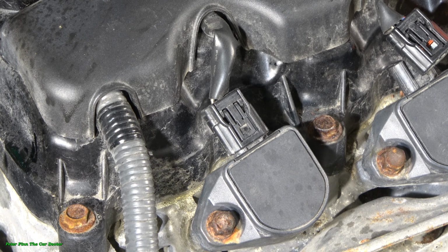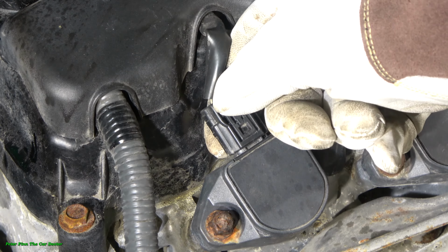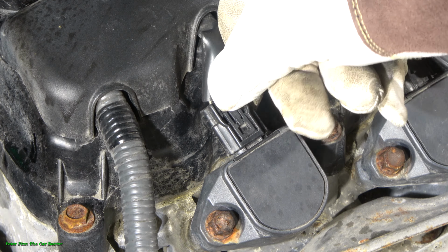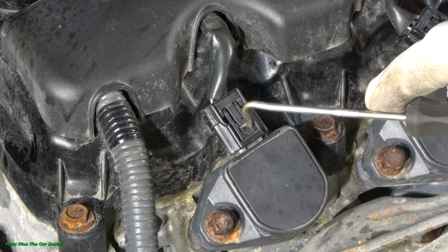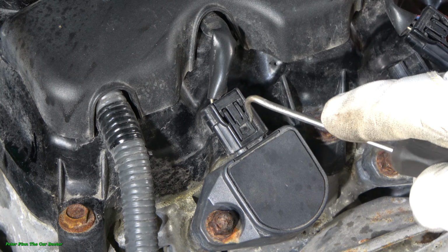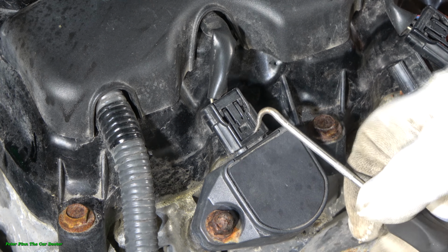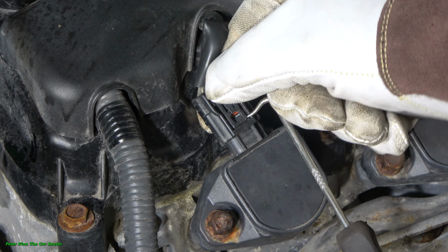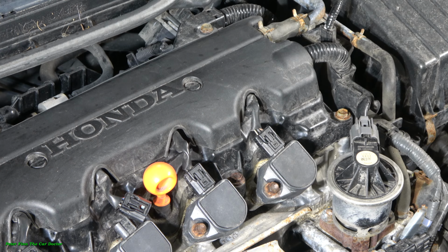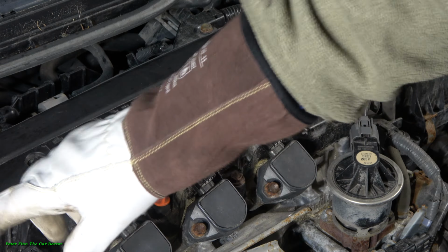Okay, now we have a nice view. And these connectors work so that when I press this area, then I move that up in this way, in that way. But sometimes these parts are stuck and I have to press this area and install my hook tool in here and lift up this central area a little bit in that way. Now it is in here, in this way, and then I move that in here, and then this opens, because sometimes these are stuck. Then I open these final two, press in here, and then move up, and press in here, and now all of these open nicely, good.